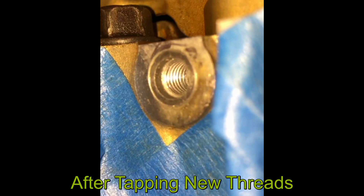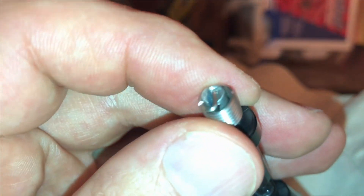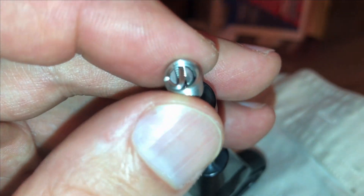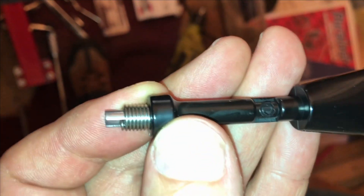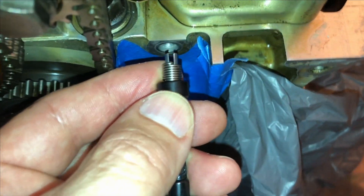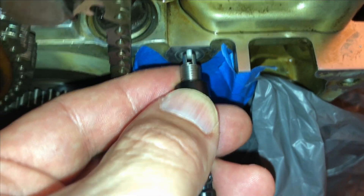Obviously I'm going to clean all that out. Now I'm going to be using the helicoil tool. I've got the helicoil here. You can see there's a tab on here that needs to insert into this groove — the tang is actually the first thing that goes into the block. I'm going to take this and, with the new threads that I have, insert the helicoil turning clockwise. The helicoil itself is now inserted.